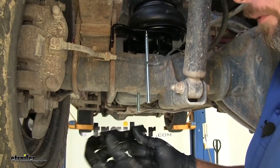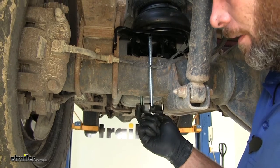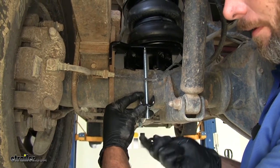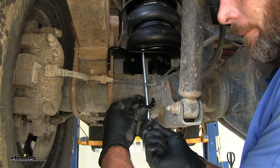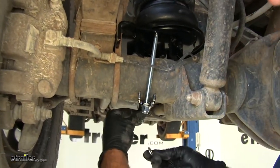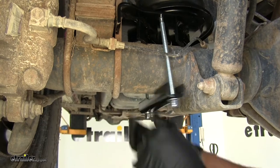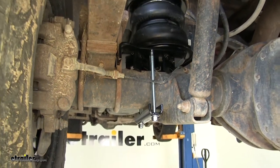The carriage bolt comes down on each side of the axle and the tabs here are going to sit on each side of those U-bolts — one on the back side and one on the front side. Now we'll bring the lower portion of our lower clamp, or axle strap, around the bottom. We'll bring that up on our U-bolts and place on our flat washer. Then we've got a 3/8 inch nylon lock nut to thread on there — just until it stops for now.